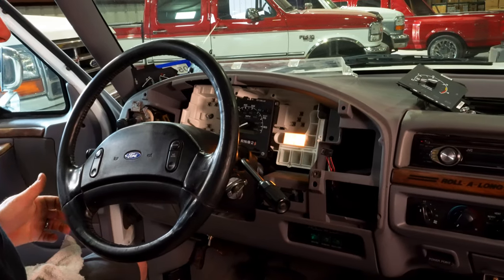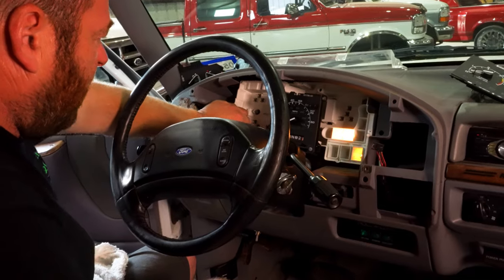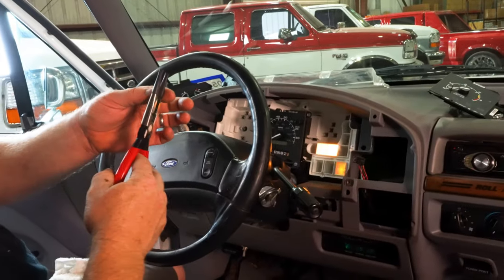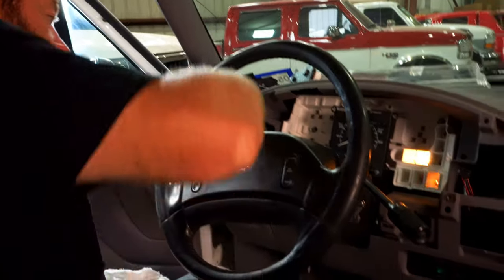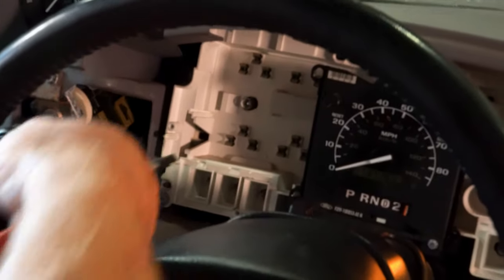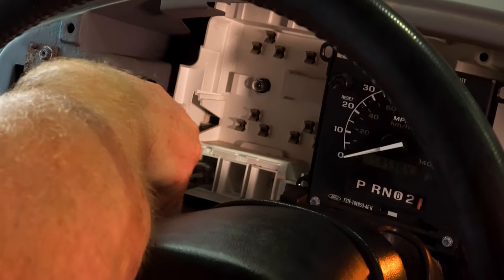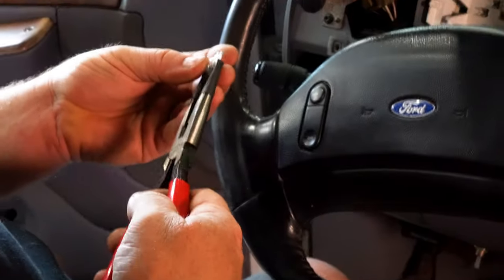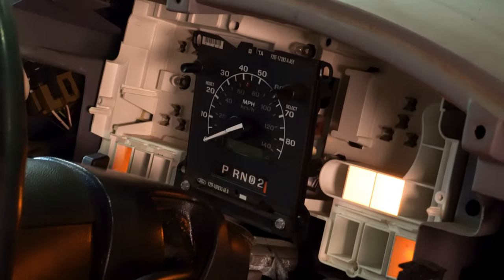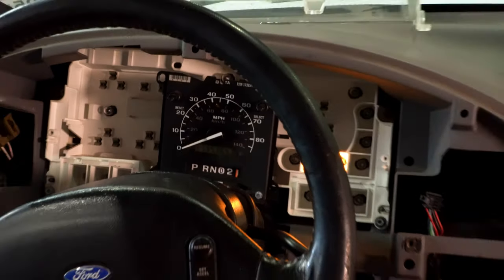Again, check our turn signal lights. We have a right one. And the left is not working for some reason. Needle nose pliers with some shrink tube on them helps grip that bulb. As I talk about getting them out of there, it starts working. Just go ahead and change him out. Okay, now we got both our flasher bulbs. Turn the key back off.